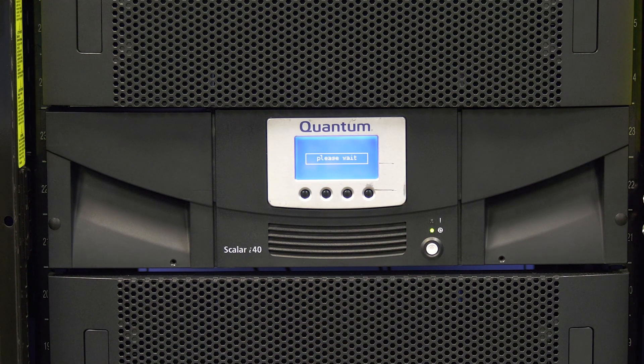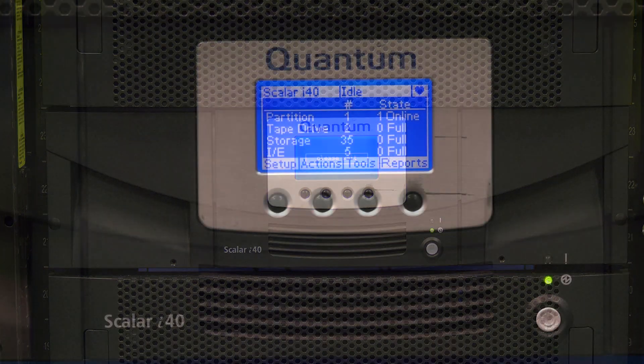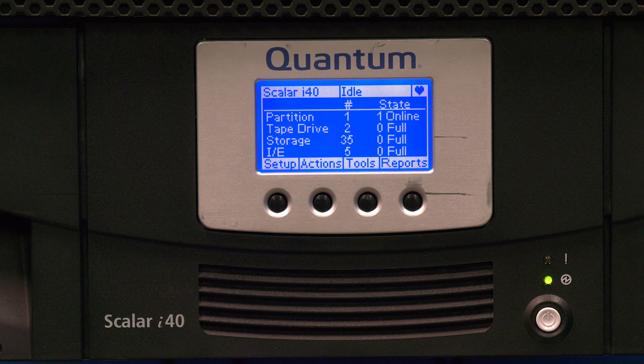The library will take approximately five to ten minutes to fully initialize depending on whether it is an I-40 or an I-80. During this time you should be able to audibly hear the robot moving around inside, doing the full initialization sweep and inventory of the machine. When the main status screen of the library appears, it is fully initialized and ready to go. You should go into the diagnostic tickets and clear any tickets related to the robotics assembly prior to putting the library into production. We recommend running an inventory on the library through your backup software to verify correct operation of the picker assembly and to ensure that your backup software has the full location of all cartridges in case any were moved during the replacement. Any questions regarding backup software should be directed to your software support or manufacturer.